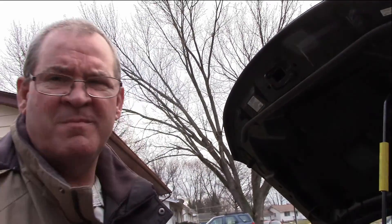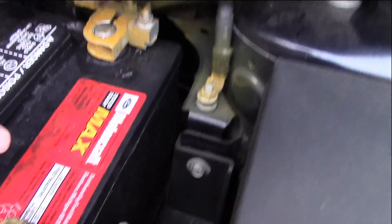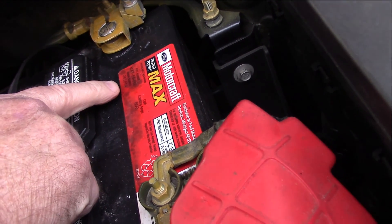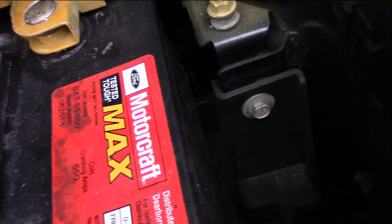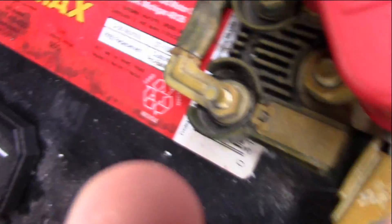This is Mac T Ford Edge and I have the Solar BA7 battery tester. I'm going to test Blueberry, which is a 2011 Ford Edge Limited. If you look at the battery right here, it is a Motorcraft Max battery — a 65-series battery, which means it has 650 cold cranking amps as stated right on the label. We're going to test the battery and charging system as a comparison to the other 2011 Ford Edge, which I think has some battery charging issues.